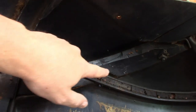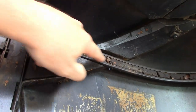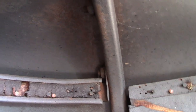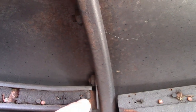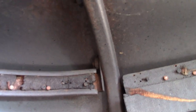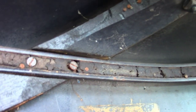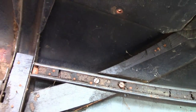Removing this piece of wood on the back here is a bit tricky. The first thing you have to do is remove this piece here, which has two screws, and then it goes through one of the bolts holding the quarter panel to the back panel. This is kind of tricky because of its angle — you can't get a socket on either side. So what I did was bend this down a little bit and I was able to get a wrench on here to loosen it up, and then I took it out the rest of the way by hand. And then there are two screws underneath here, and then there's this screw which goes through all the way to the outside of the body, and then it's got a bunch of nails on the other side holding it to the sheet metal. After you remove all that, it just drops right out.